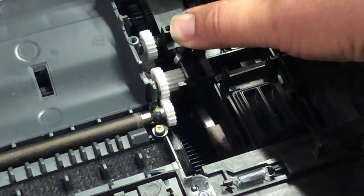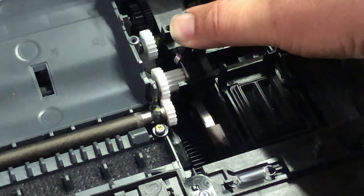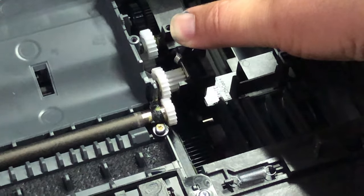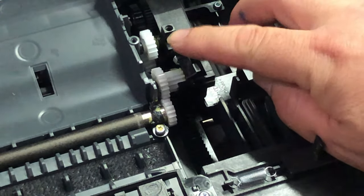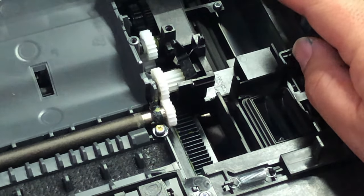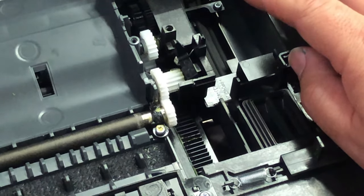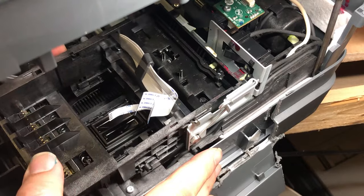Let's control this lever. The lever is controlled by the printhead carriage. If I want to lower the platform, I need to move the carriage to the right. What if the printer is out of sync? The platform is raised and it's trying to move to the left — carriage jam. Welcome to wonderful HP design. Let's do HP's job and fix this.